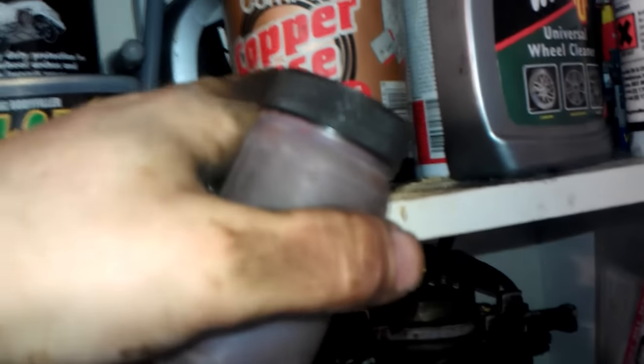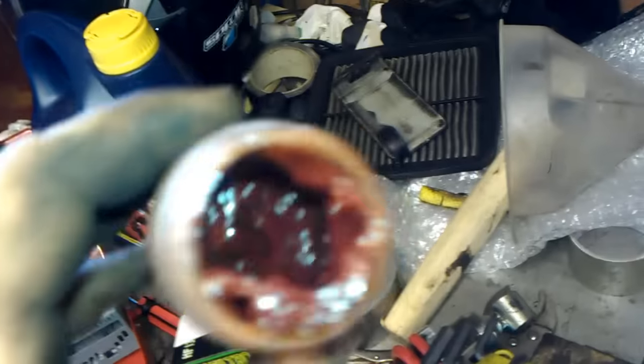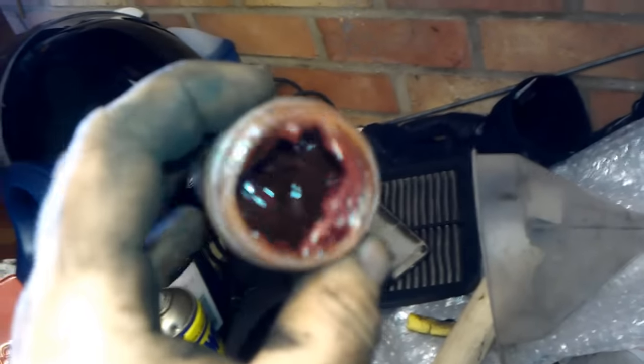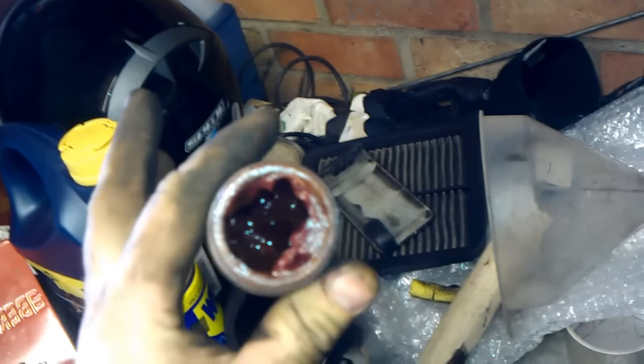There are different types of grease you can use. In my cupboard I've got copper grease, which a lot of old-school people like, but I don't like it because over time it turns to powder and loses its effectiveness. You've got normal LM grease, which is general purpose. You can use CV grease, which is really good because it's water resistant. But what I like using is red rubber grease — I use it on brake caliper sliders a lot. It's highly resistant to corrosive agents, solvents, and water. Stick that on and it stays on, it doesn't wash away. A little tub like this costs a couple of pounds — or a couple of dollars for you folks in the US — and I've had this for years, done loads of brake calipers and all sorts with it and still got loads left. You do not need a lot.